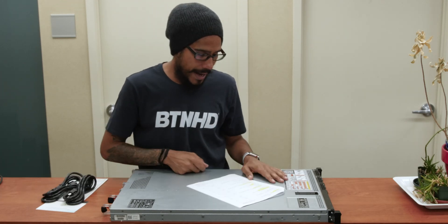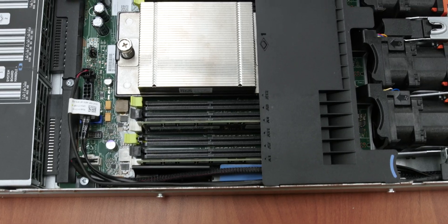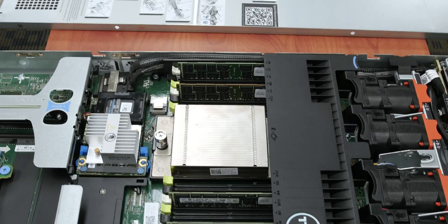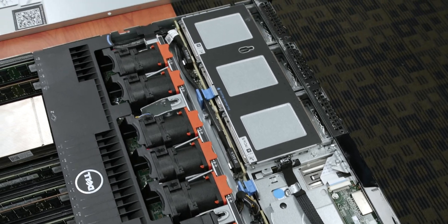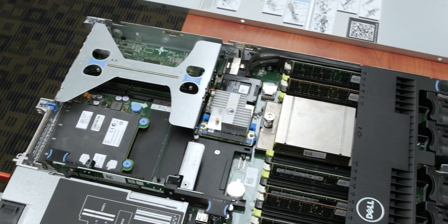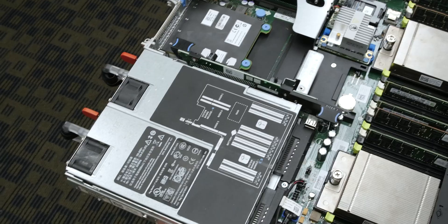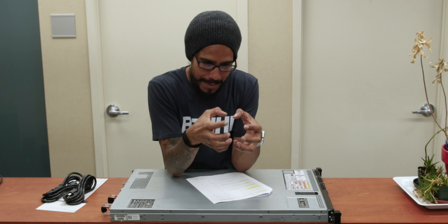So I got my cheat sheet on how I got this machine spec'd out. This is the Dell PowerEdge R620. It comes with four, eight, or twelve drive bays — I got the one with eight drives. It comes with two CPU sockets. I actually got two processors: eight-core Intel Xeon E5-2660 series. 64 gigs of memory. We have the H710 RAID controller. All eight drive bays are filled with 300 gig, 10K RPM SAS 2.5-inch hard drives. I wanted one to two terabytes but the price would have gone over $1,000, so I stayed on budget.